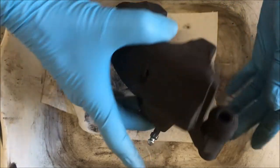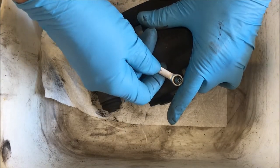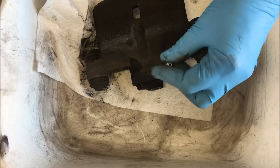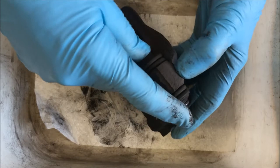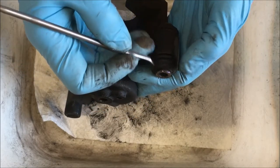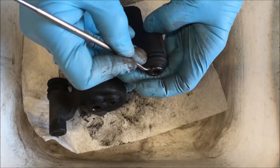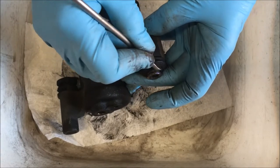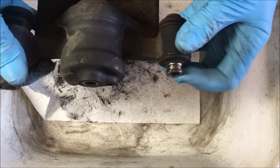The first thing you want to do is remove the brake bleeder bolt. I'm going to take this 8 millimeter wrench - I don't want to damage it - take that off and set it to the side to clean independently. That allows me to turn the caliper in every direction without harming the bleeder bolt. With the bleeder bolt out, I need to take the slide out. It's got a little groove around the slide and I need to push the boot back away from the slide itself - I don't want to tear that boot because I want to reuse it.